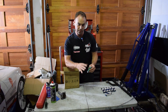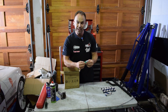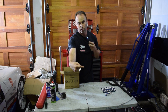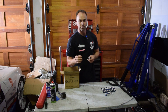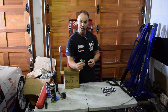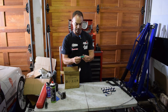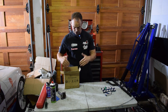The other variable we had — from the Maputi races — was injectors not firing correctly. To eliminate any lean condition, even though we have a lambda sensor in the exhaust, it's only at the back after the collector, so we don't know individually if a cylinder is running lean. If it picks up knock, it'll reduce timing, but it might be too late. So we're changing to brand new Bosch 440cc injectors — just the right thing to do. These will really protect the motor and enable it to run perfectly.